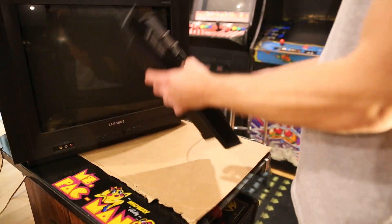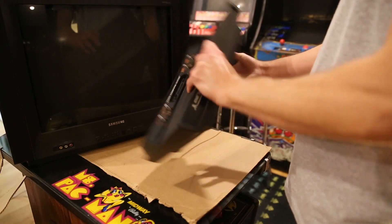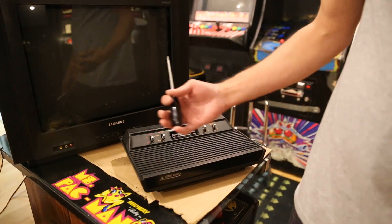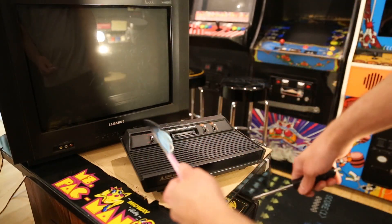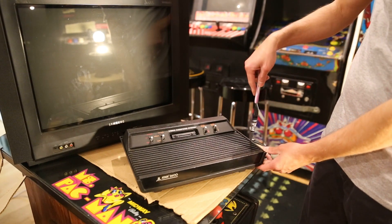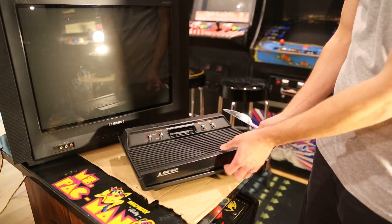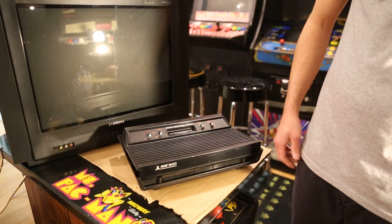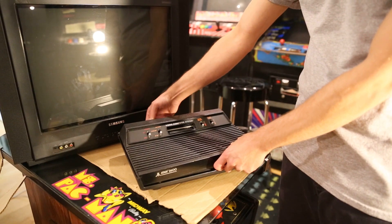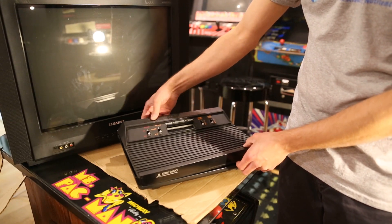For the teardown, it's very basic. There are four screws — here, here, and one sunken at an angle — I've already removed those to make it a little easier. You're going to need a couple of things: one would be a screwdriver, and I'm going to use a butter knife. I know it's really technical stuff. The easiest way to get this off is to just carefully pop it out — keep in mind I've removed the screws already. It's a little tricky to get all your ports, switches, and everything lined up correctly.